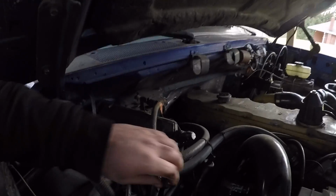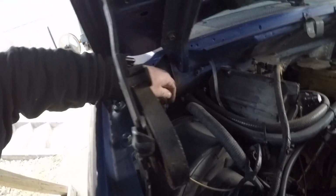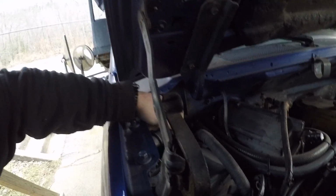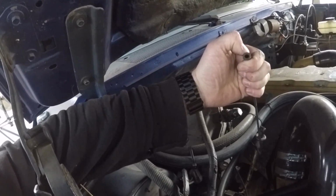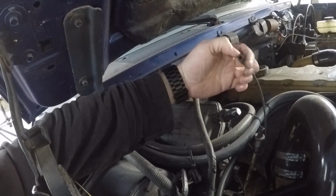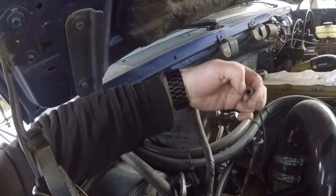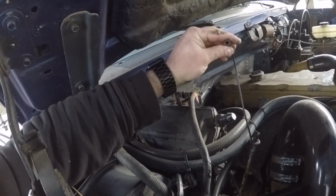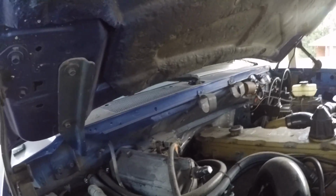And then the heater controls, they are vacuum powered, so they used to tie into the vacuum pump, which is right here. And without vacuum, none of the doors will open, because that's how they all run. I don't know how it works, but somehow it tells vacuum to go here or there, and it sucks in on a diaphragm, opens and closes blend doors and stuff. So I got a Venturi, and I'm going to get a vacuum pressure switch, so when it needs more vacuum on this system, that switch will open or close and kick on a solenoid that'll send pressure through the Venturi, which will suck the air out of this, which really there's not much to it, so it should just be like a psht. So we'll see how that goes, though, 'cause nothing ever goes as planned.